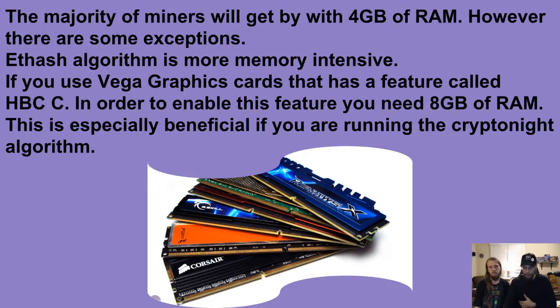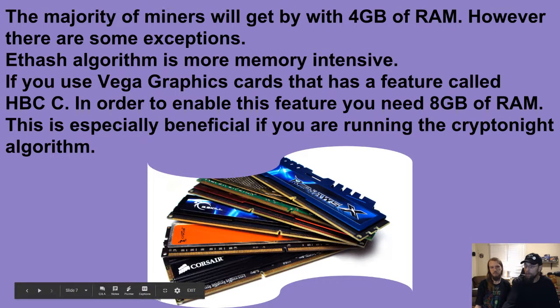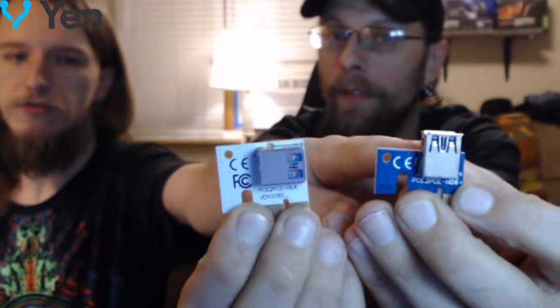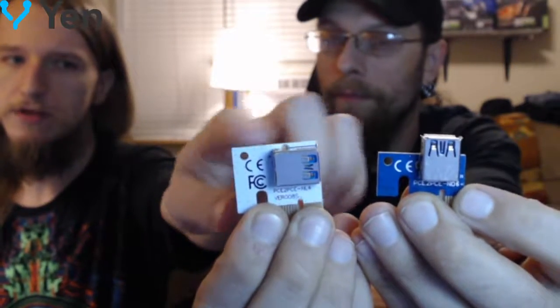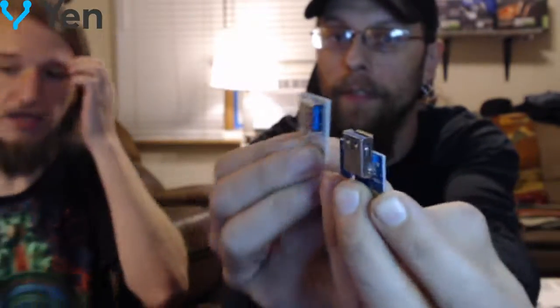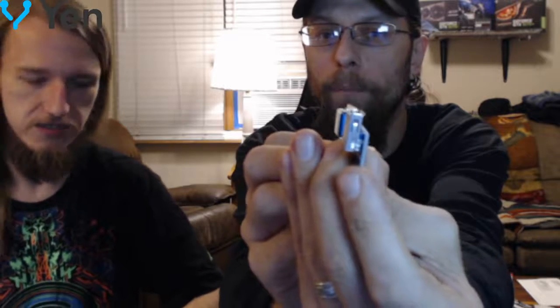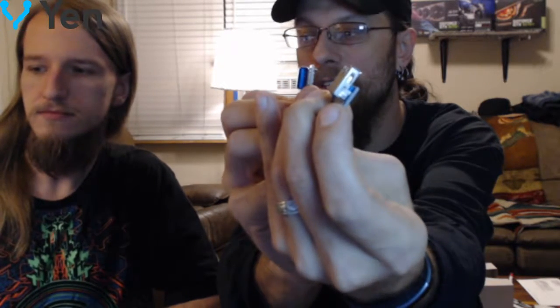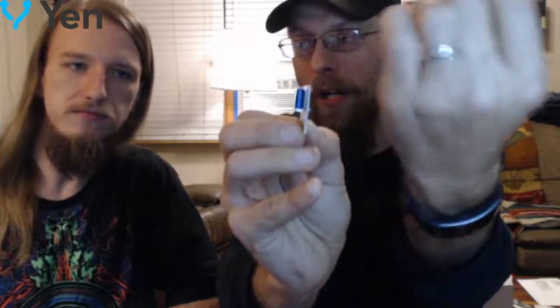Let me show you some of my equipment. When I was talking about the little 16x-to-1x adapters, this is what these are. This one here has the cable going straight up, and this one has it going off to the side. If you have another one of these right next to it, it'll block the cable. If they're in line, it'll tilt the next one off to the side because the cable is pushing it, which will cause it to actually disconnect — and you'll have GPU drop-offs, which does happen.